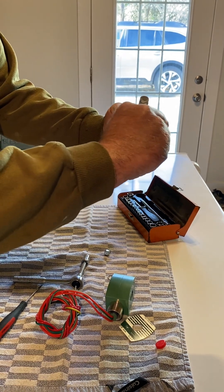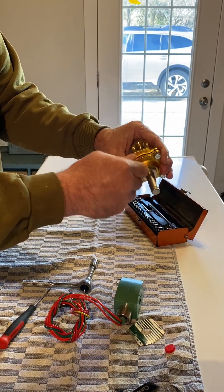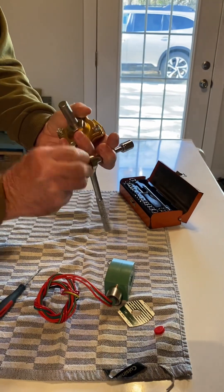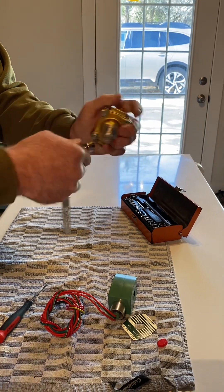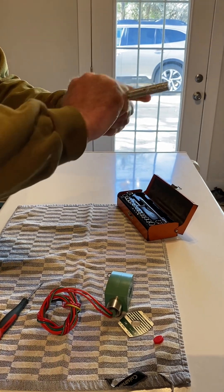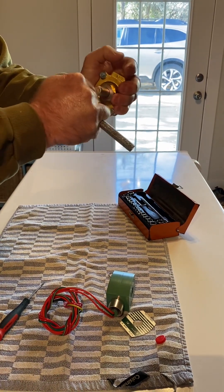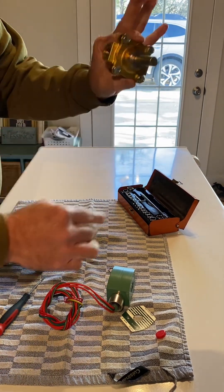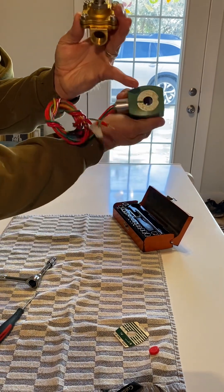You don't have to put 2,000 pounds of torque on these — obviously they've got to be more than finger tight. We're going to tighten them up going crisscross, just snugging it up so the gasket seals properly. Start tightening a little more, a little more, until we're snugged up, then work your way around clockwise or counterclockwise. Now we've got this assembled — it's going to hold water and hold back pressure. We're going to put our spring back on and then put our power head on.